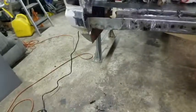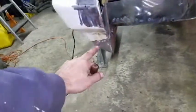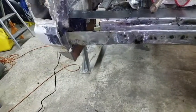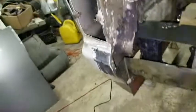That's what I've been doing for the past week — pretty much all I've been doing for two weeks. I had to cut this out and put a patch in so I could weld something to it, because this was all eaten away. You can just see the kind of crappy work that the body shop did. They just bonded the hell out of it, and that just made a bad situation worse.